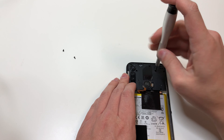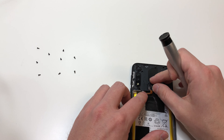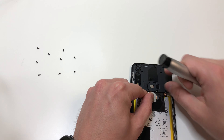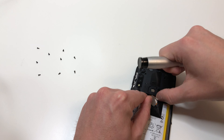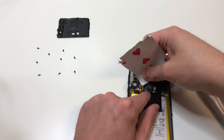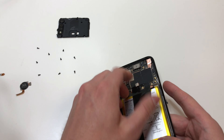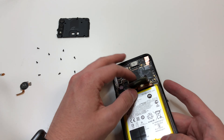With the Torx driver, remove all the screws on the top panel. To remove this panel, push the fingerprint scanner down and lift up the panel in the bottom area. Once this is off, we can unplug the fingerprint scanner, get that out of the way, and move this little black cover so we have access to the battery and the screen connector.